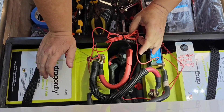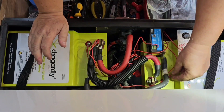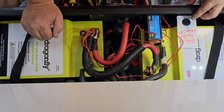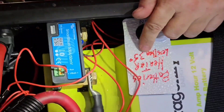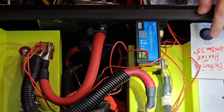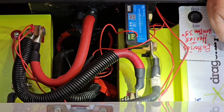Everything is connected now. I've got the battery heaters hooked up — I made a little switch so we can control them. It's just double-sided tape, and when he wants the battery heaters he just flips it on; there's a little light so he knows it's on. You want to turn this on whenever the outside temperature is going to be less than 35°F, because you don't want to charge a lithium battery below freezing. When it's 35 degrees, flip the battery heaters on — they use one amp per hour, possibly two amps if each battery draws one amp.